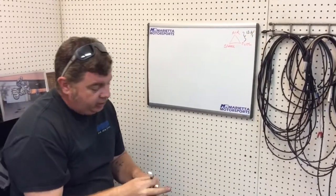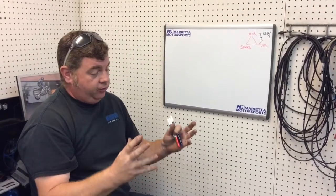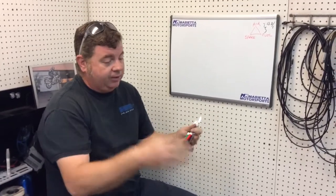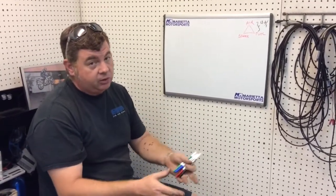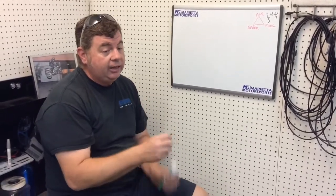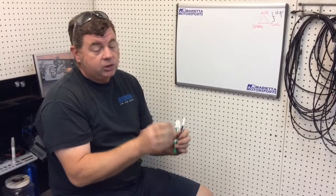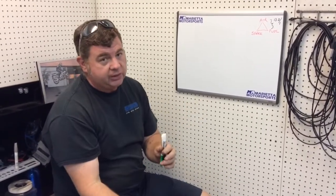And that's the ratio we use. 13.2 parts air to 1 part fuel. So for every, made up thing, ounce of fuel that goes in, 13.2 ounces of air has to go in to make the ratio that burns correctly. If it's too rich, it burns too slow. If it's too lean, it burns with a bang. So the correct ratio actually just expands really quickly to push the piston down.